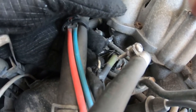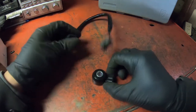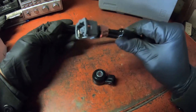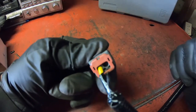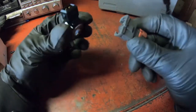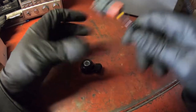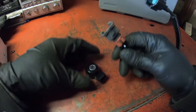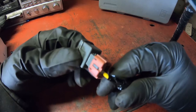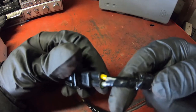That's the wire I'm going to tap into — the white wire right there. Here's the part that I ordered: the knock sensor and a wiring harness. Something that's weird about this wiring harness — if you look at it, the harness that connects to the knock sensor only has one terminal, only one wire coming out. So does that mean the knock sensor grounds itself? That's kind of interesting.